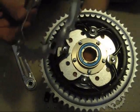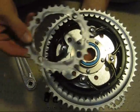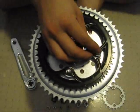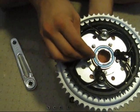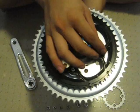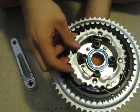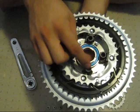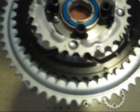Next is the 32 tooth chain ring, and before I put that on I have to have the right spacing so it'll change gears the way it's supposed to. That's why I have these little brackets. I'm going to put these on each one, and when in place they rise up and provide the right spacing. So now when I put this on, you can see these are rising up, and these little threaded posts will accept the 22 tooth chain ring.